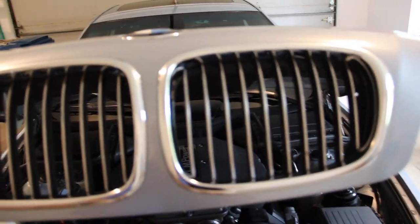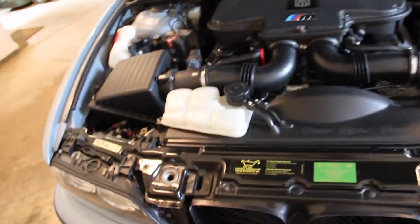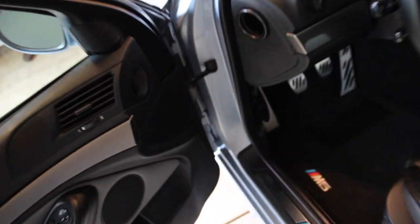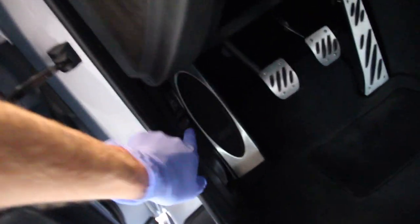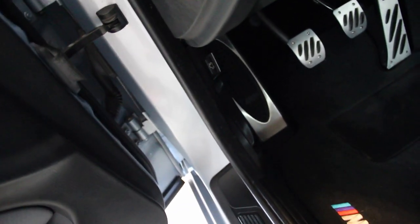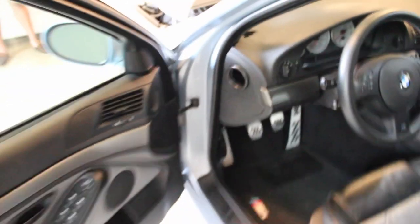Should they break, you're stuck with your hood closed and no way to open it, which is not a good situation. If that has happened to you, you unfortunately have to destroy your kidney grills and saw or break them out, then manually trip the latches — there are DIYs online for that. If the cable broke inside the car, you can remove the handle with a Phillips head screw, grab the piece of the cable that isn't broken with some pliers and pull it. That's what happened to me on Christmas Day 2012.